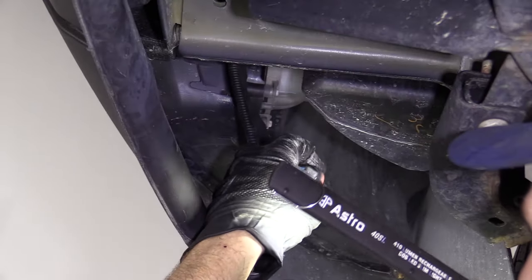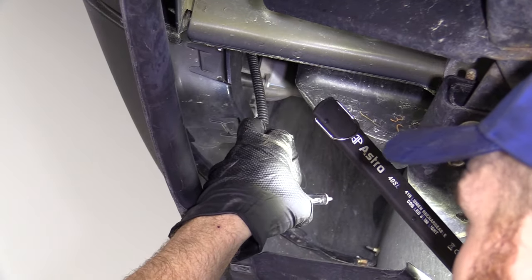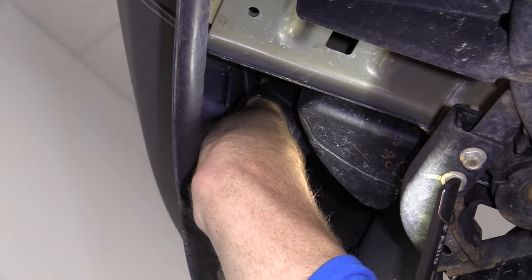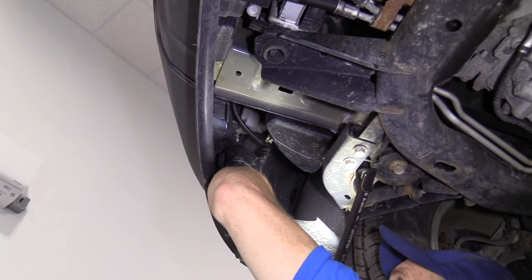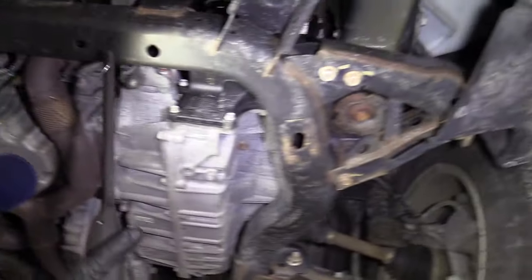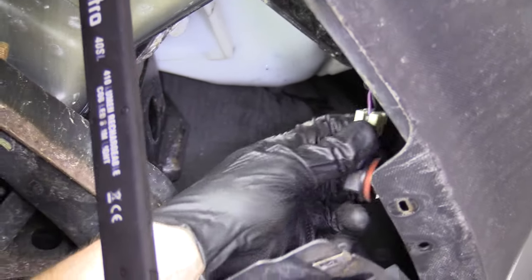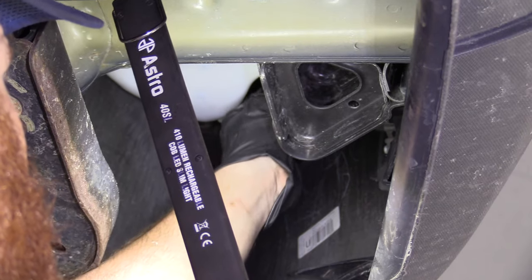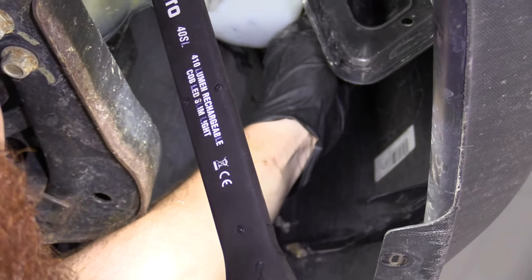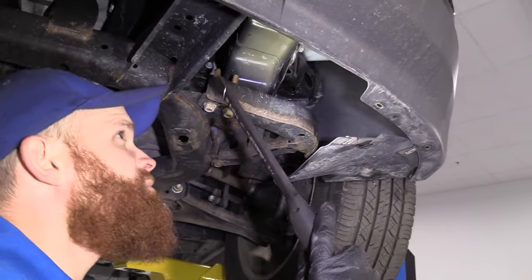Now we're going to put in our fog lamps. Once again, we're going to be very careful not to touch that glass. We'll check them one more time to make sure the filament's not broken after all that moving around. I'm just going to take it, put it up in here, start by going all the way counterclockwise as far as I can, and then turn it to the right so it locks in. It should be straight up and down in the locked-in position. Filament's not broken, nothing moving around, I didn't touch the glass. Bring it over, turn all the way counterclockwise until it grabs, bring it back to the right. Once it sets in, bring it down — it's locked, in the straight up and down position. All ears are in.